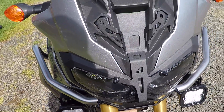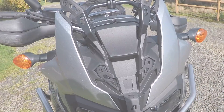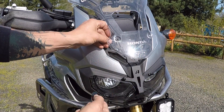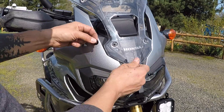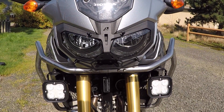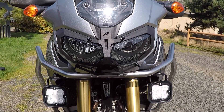All I've got to do now is put the windshield back on and install these with the plastic washers. So I've got these two plastic washers here — they're going to go in between the bracket and the windshield to keep it from cracking and keep it from getting scuffed up. Alright, so I've got the four bolts in. Now I'm just going to put the guard on and that'll be it.